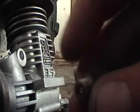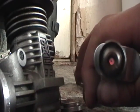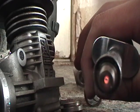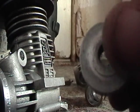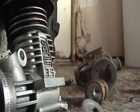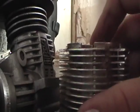And then you've got a glow plug too for starting it. I don't know if this glow plug is good — it's barely good, like burnt out most of the way. And then you have your head, and that's where the glow plug goes. You have between one and like eight head shims. Here is your cooling tower, cooling head, heat sink — this is on top of the head and it really helps your engine run cooler.